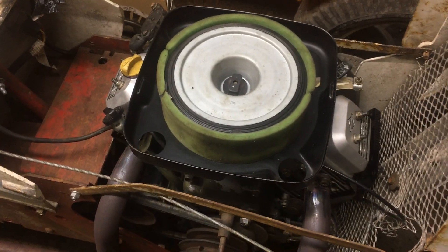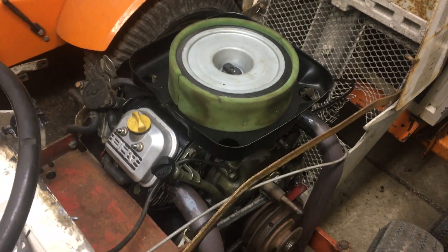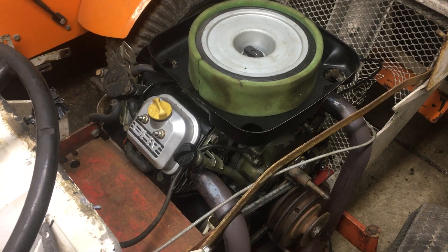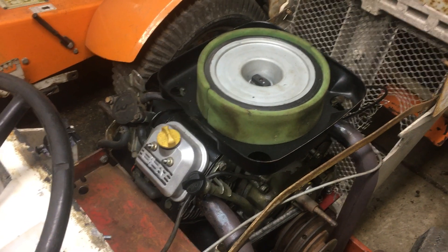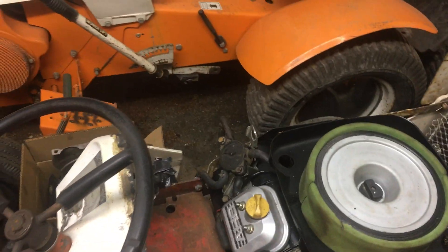It's something to be aware of when you're hopping up these Vanguards, but overall they're very, very stout motors. Midwest Super Cub with their pulling tractors primarily deals with Kohler Commands and has a lot of parts to make those decent, but there are a lot of parts out there for Vanguards as well. At the end of the day you're probably going to spend about the same amount of money to hop up one of these engines to the same level. If you want to hear this thing run, I've got other videos on my channel from a couple months ago. It's currently packed away for winter, and it's so darn loud I don't even like running it around the house since it's straight piped.